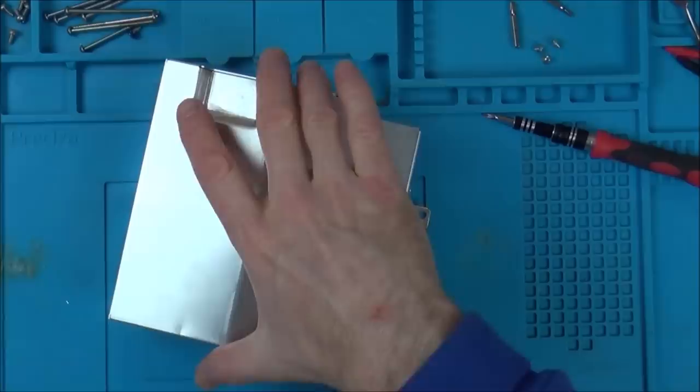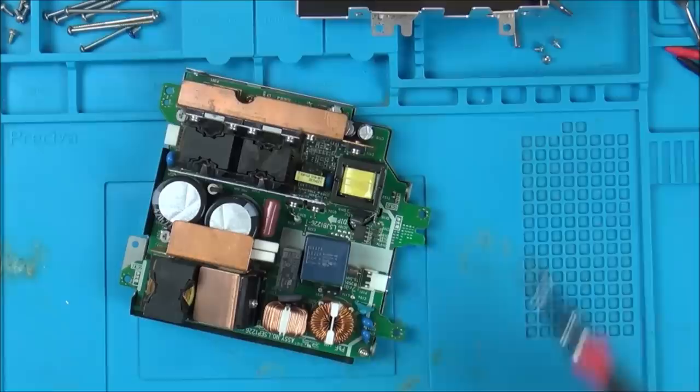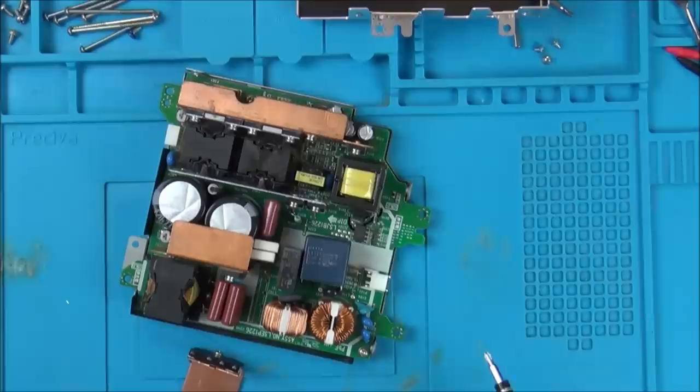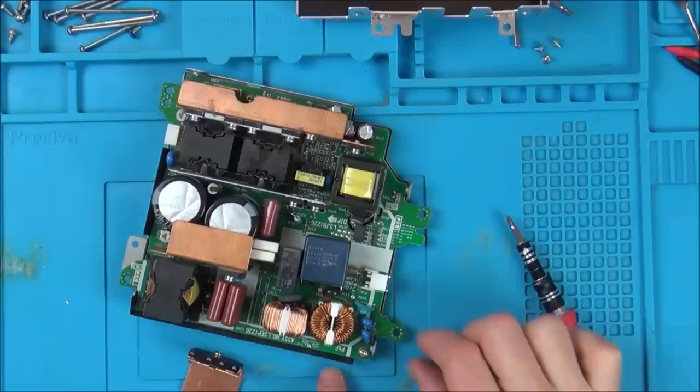Right, okay. There we go. Bridge rectifier, I reckon that is. Look at that! Amazing. Okay, be careful now. So that's completely broken off from there, but you know what? That might be repairable if I can actually just get onto the contacts. Let's try to get the power out of this board because there's two mean looking capacitors and they look like there's a lot of power there to shock me. So let's see if we can get to the other side of this.